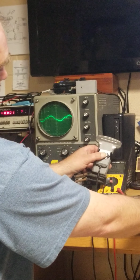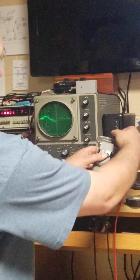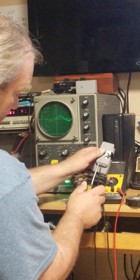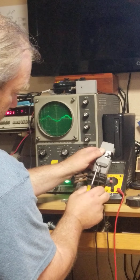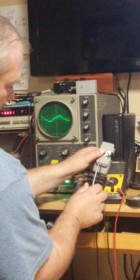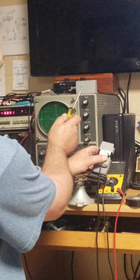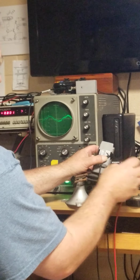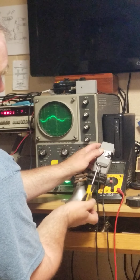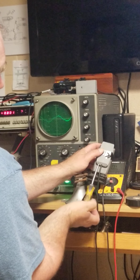Anytime that happens, you think you've gone too far, maxed out there. There must not be enough metal in this seatbelt. But anytime you get an LED indication with the tab removed, that tells you that you need to screw this screw back in some. So we're going to screw the screw back in some, and take it down quite a bit.